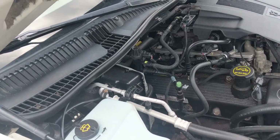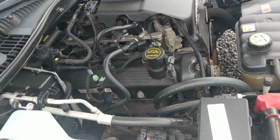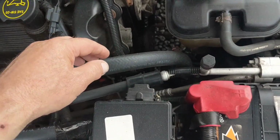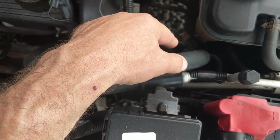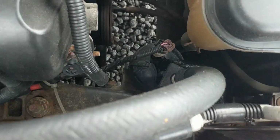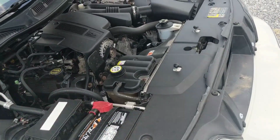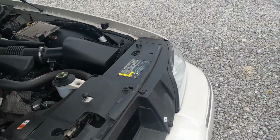The other thing I do want to give a couple hints or tips on is if in '03 and up, if you are losing refrigerant from your AC system, Ford redesigned where they put their receiver dryer, and it's made of painted steel, and they wrapped it in a plastic container. Well, that thing does what it's supposed to do, and it has it right now, condensation. It gathers at the bottom and rots the bottom of the receiver dryer out. My shop charges me to put a new one on and recharge the system properly. It's about $125, and it's done right.